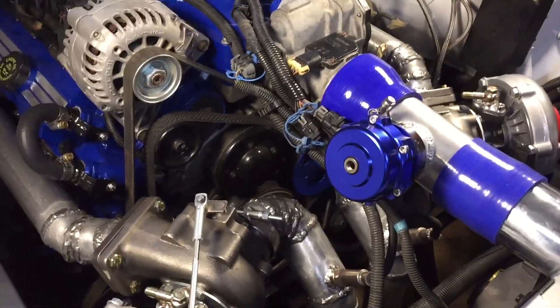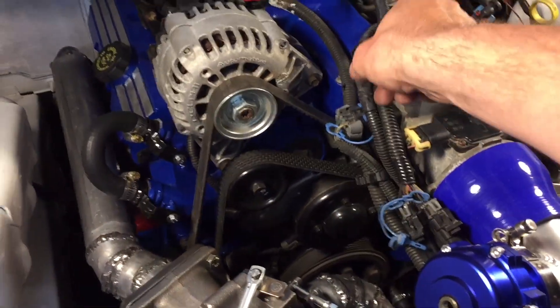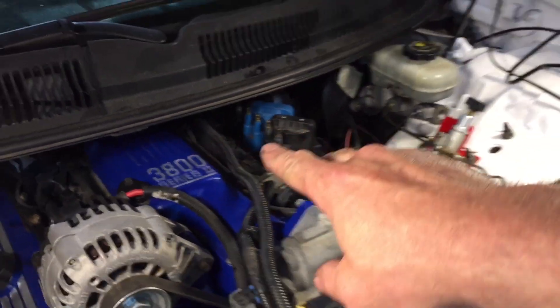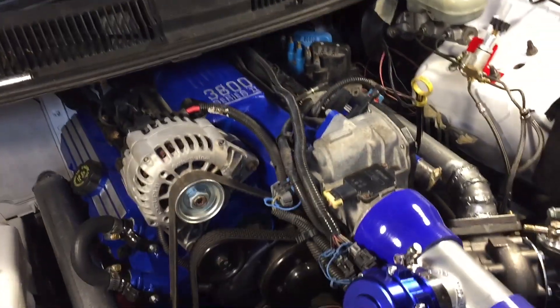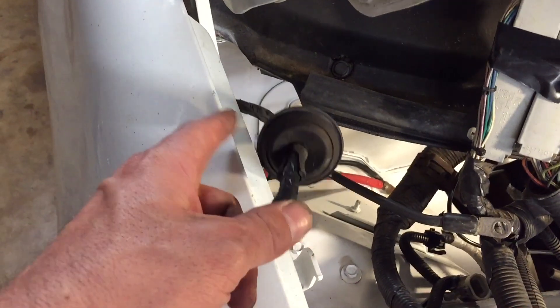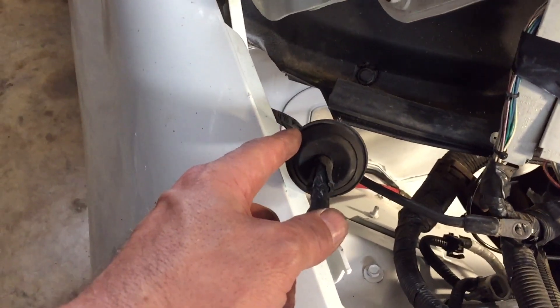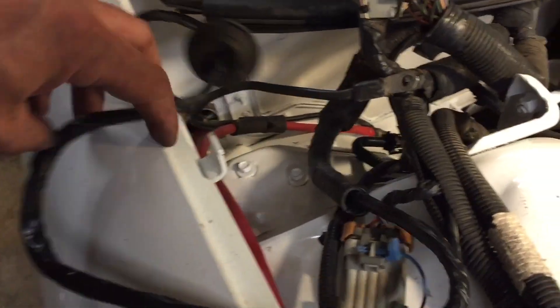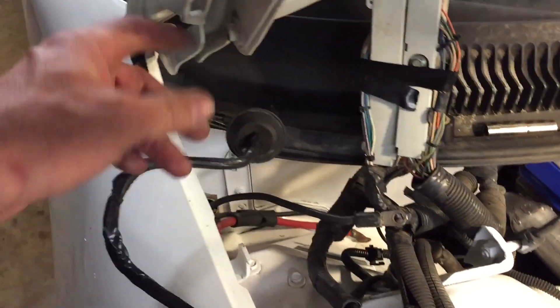I also figured out the O2 sensor wiring and how it fits with the harness. This is the jumper harness I made for my O2 sensors, routed all the way across. I still have to solder on the ends in the back where it breaks off to left and right sides — bank one and bank two. I ended up cutting this piece off the grommet at the firewall so it can stretch and I can jam those four wires through there. I am so damn happy I finally got this figured out because it was really wearing on me. It's coming along and we're about done.